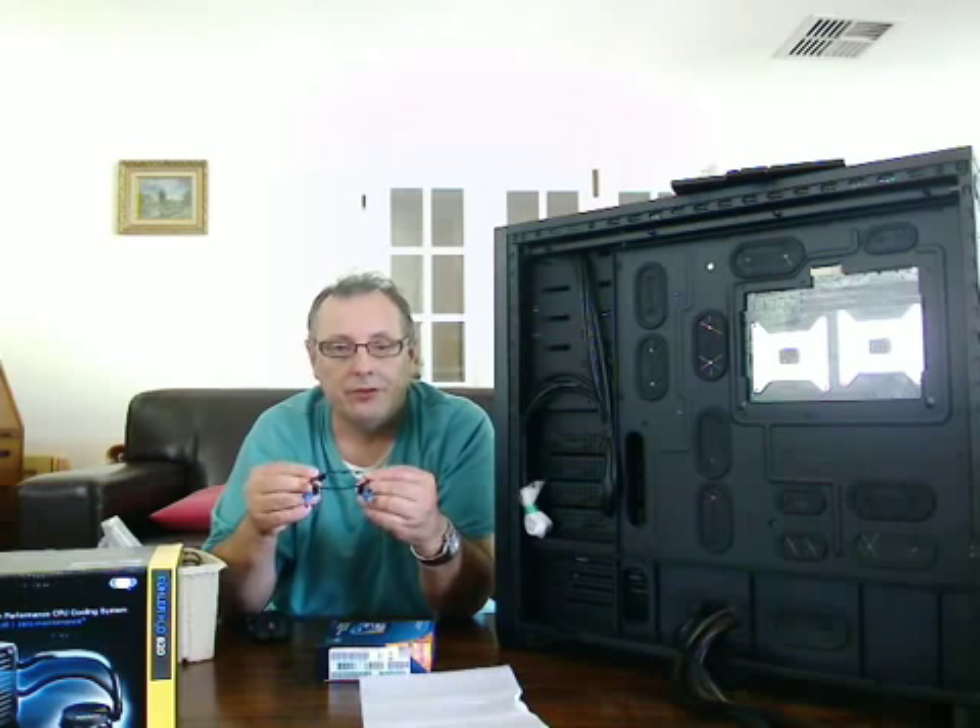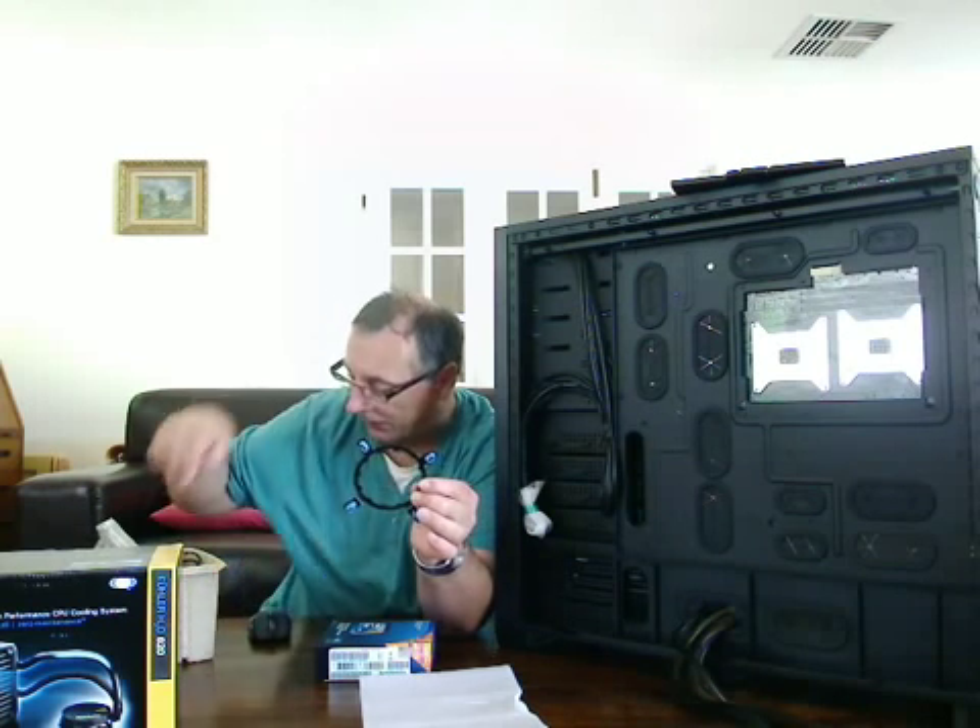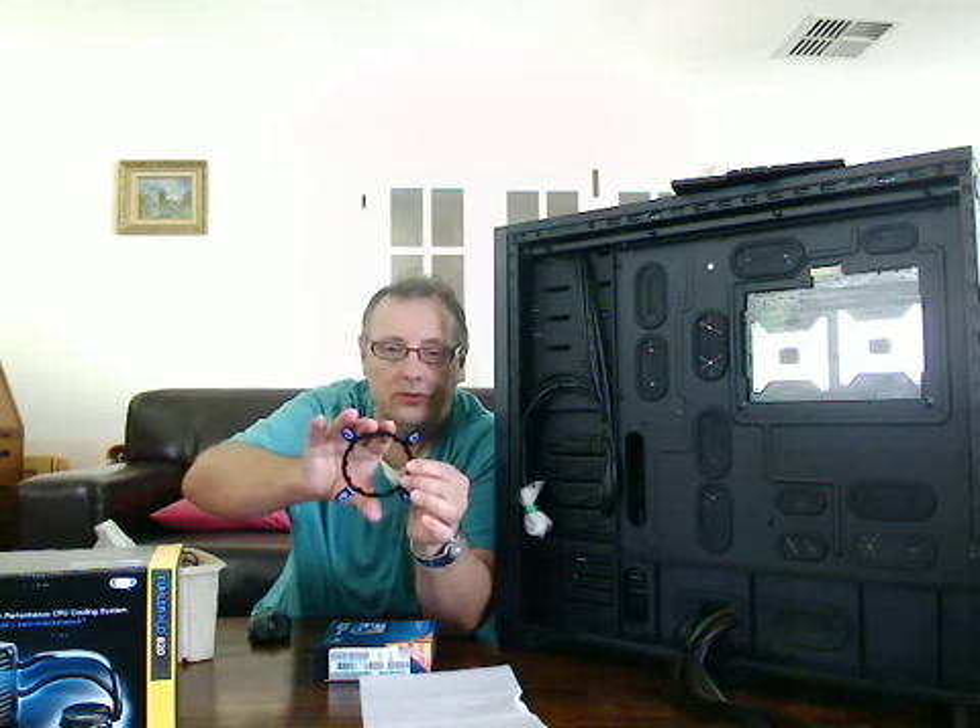The only thing I need to attach is this piece at the front of the motherboard, which will allow the water cooling pump to line up over the CPU easily. I've put this together a little bit to give you an idea of how it works — you've got a variety of screws and grommets which you attach appropriately for your particular CPU. I'll fit that in due course.